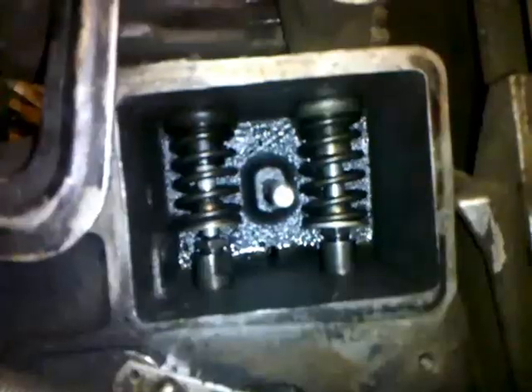I've got the compressor on here. What it's doing is at the top it's holding down the valve, and here it's pressing up the spring. I didn't understand what I was supposed to be doing — I should have put the compressor under the retainer and pulled the retainer up. There are these two little metal retainers that retain the retainer, and they would have just fallen right out.